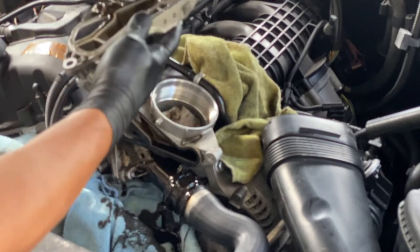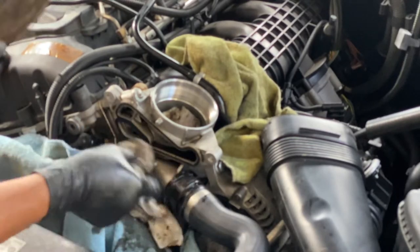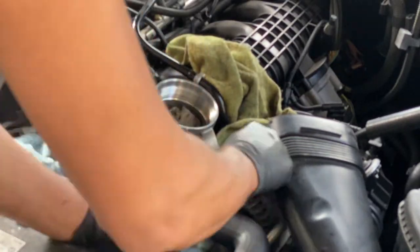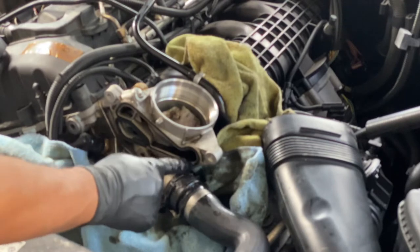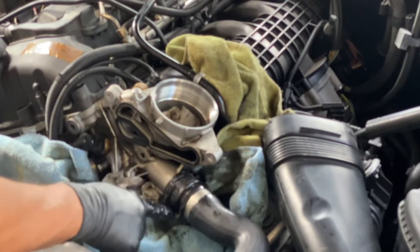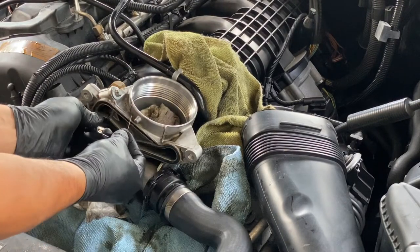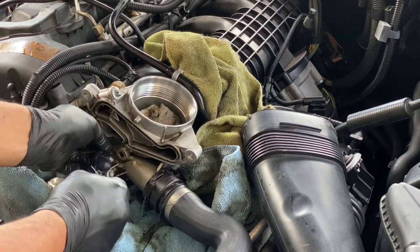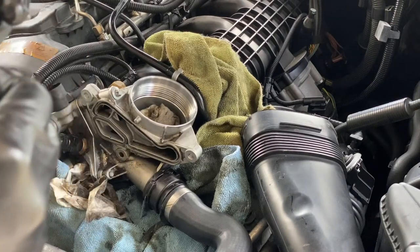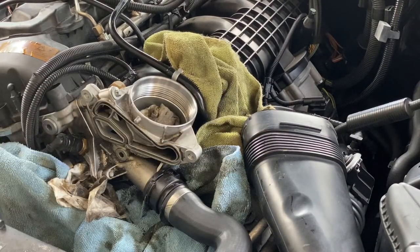You can see how bad and messy this gets. That's what's happening over time — the seal gets bad and it drips right here, the oil drips down and then falls on your belt, creating a mess. I was able to use a safety pin and pulled it out, and it came right out. I can already feel it's so hard and brittle — you can see it already broke right off. It's really hard — it's time for me to change it.